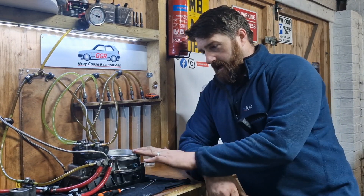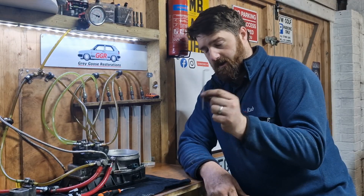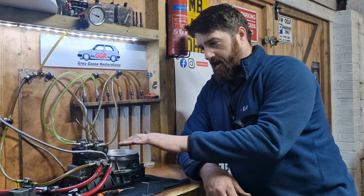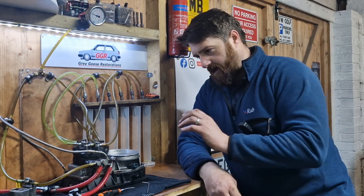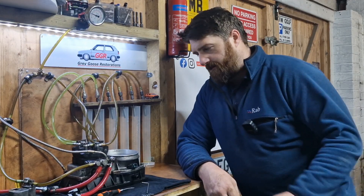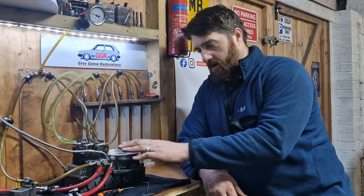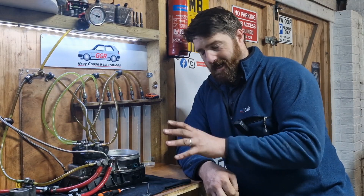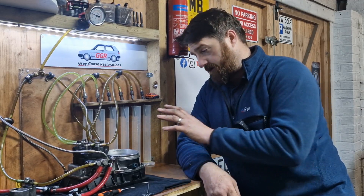Welcome back. The air plate and the fuel distributor work hand in hand, and there's a setting done with a 3mm Allen key - a quite long one that fits down the hole. That gets the air plate and the fuel distributor to the right fuel level. This is probably the most common issue - whether it's metering heads needing tweaking or people running rich or lean. I'll go through setting the air plate up with this metering head from a Porsche, then move over to the demo cut-apart so you can see what we're looking at.